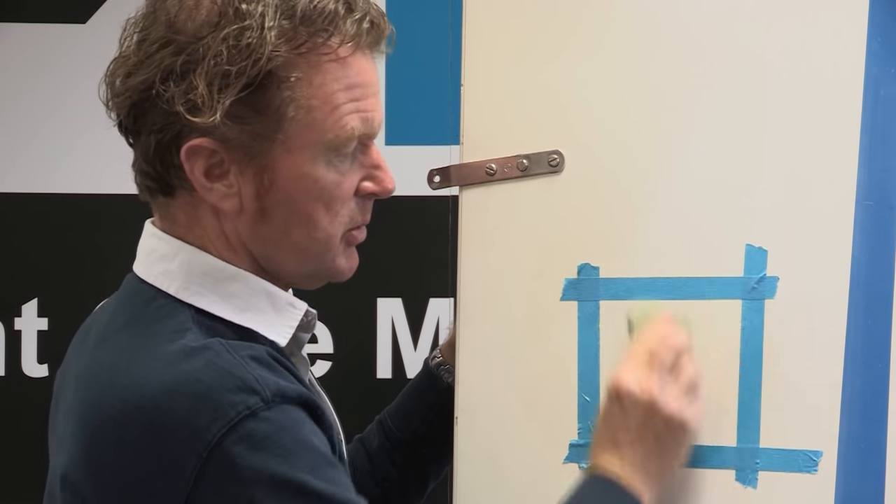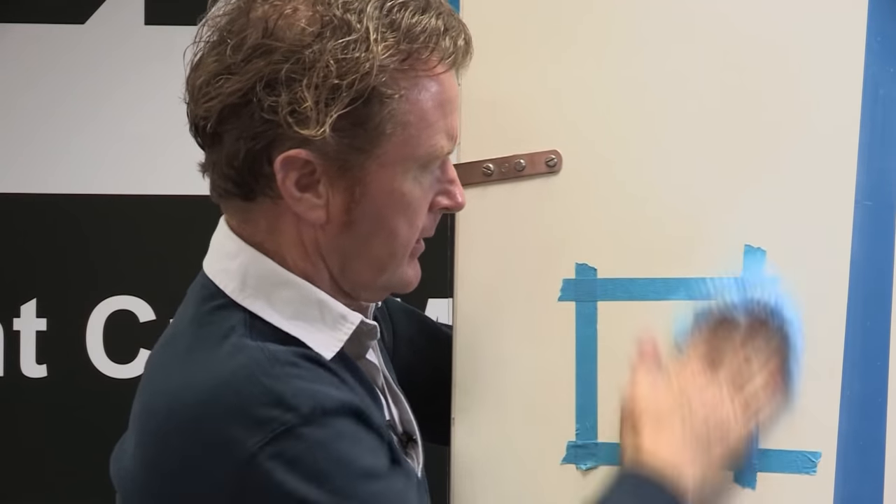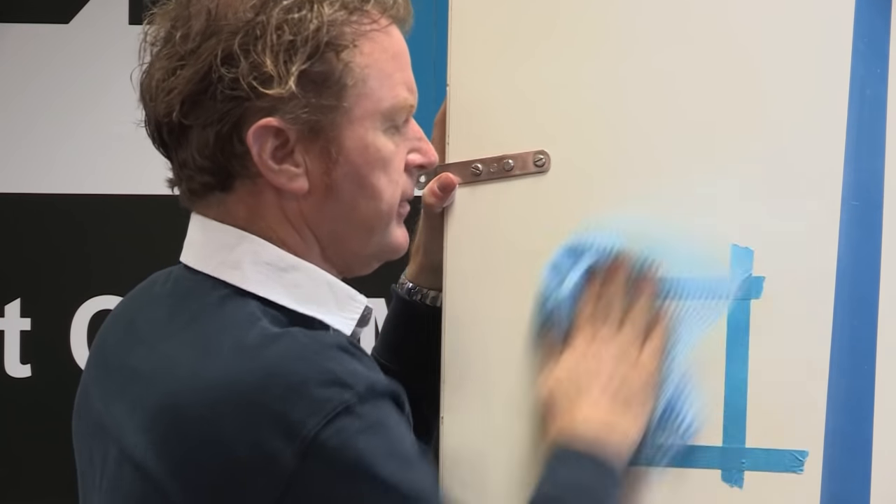To manufacture our backing plate, I need to be able to release it away from the existing hull, and to do that I need to use some release wax. This is a dedicated mould release wax produced for GRP moulding work, but actually simonised wax from the yellow tin will work perfectly well. We apply that with a sponge, making sure we cover the entire surface area and that the masking tape is well attached. Get plenty of wax on there, then use a clean cloth to burnish it up. Put another coat on - you generate a little bit of heat, it seals the wax and creates a thin film of release wax upon which we can laminate our backing plate.